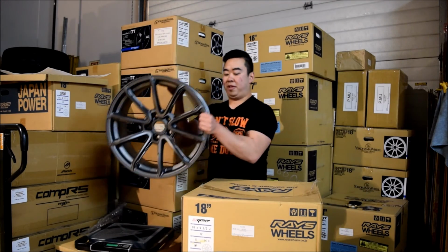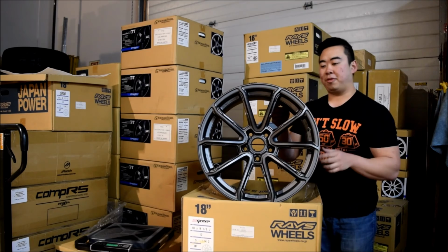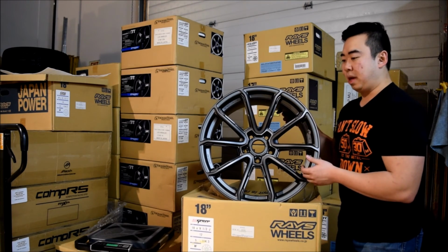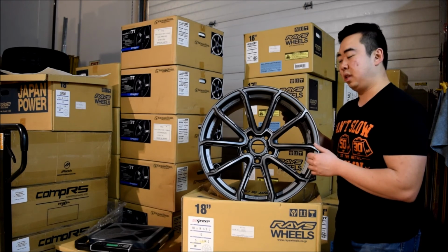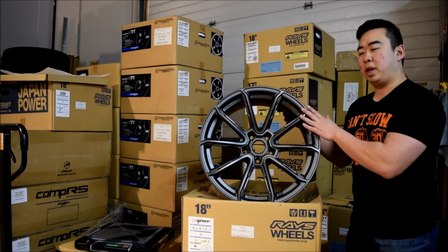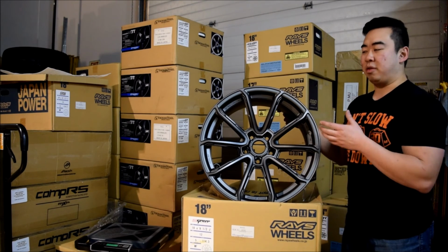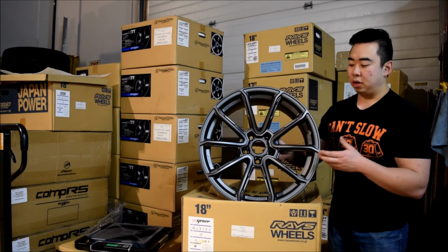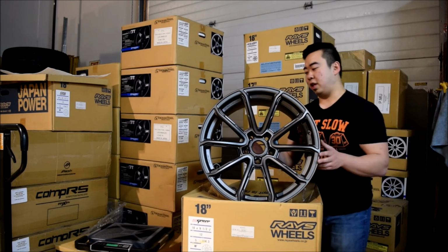That's a really good weight for a wheel of this size. That isn't forged, it's been casted. And a stock FRS wheel at 17 by 7.5 inches is going to be around 22.5 pounds. So this wheel, 1 inch in diameter increase, 2 inches in width increase, exact same weight. So that's what concludes my wheel review video.